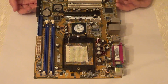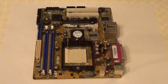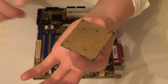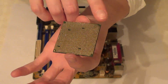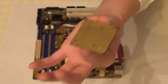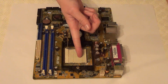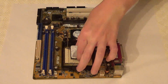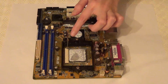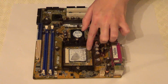So let's say this is our new motherboard. The first thing we need to do is pop the processor in. Now, as you can see on this processor, there are certain locating sections, and there are certain pins that are missing, which will match up to the holes and areas on the motherboard. So this will fit in, and to secure that in, we put the arm down and click it into place.